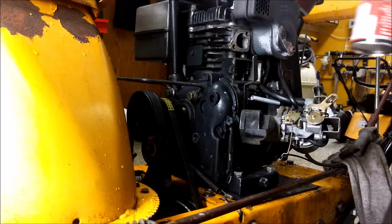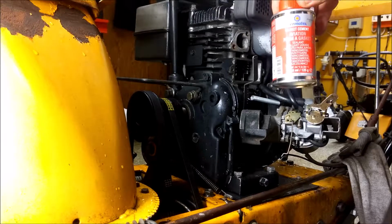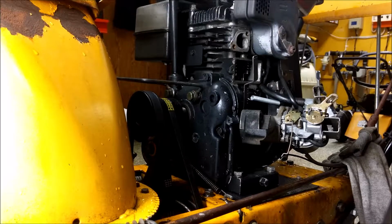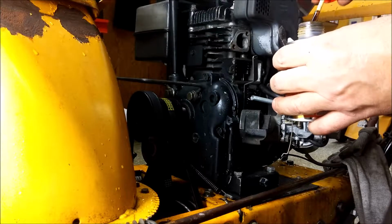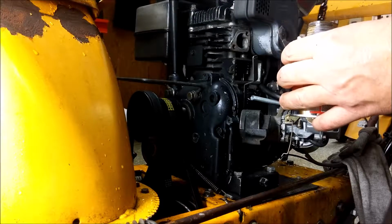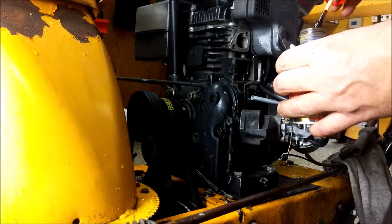Get some Permatex, form a gasket. It's basically a gasket glue. So you use this with gaskets. This doesn't work without a gasket. But this is the best stuff. If I can open it, oh there you go. It's really messy. This one is brand new, this can, so you always get a lot of glue up above the brush. Try to get it off as much as possible so it doesn't drip everywhere.